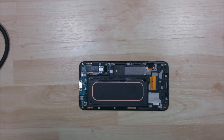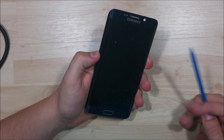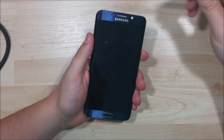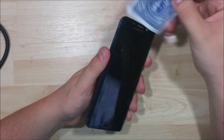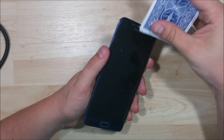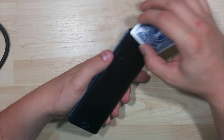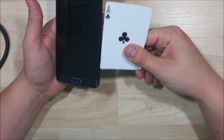I'll eventually buy a broken S6 Edge Plus — maybe I'll break this one, who knows — then I'll make a video of that screen assembly change. Check back and I'll post it on here as well. The process is basically the same as the S6 Edge, and I have a video on that — I'll try to throw it down in the description. But you're going to heat up the top here and basically take a card and loosen up all the adhesive holding the top on. The reason I'm suggesting a playing card is because it'll bend around the curve of the edge, which makes it a little bit easier, especially if you're trying to save your screen.